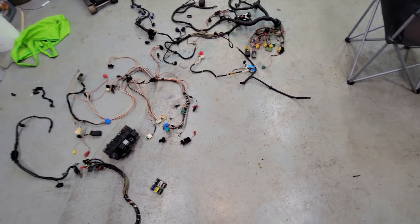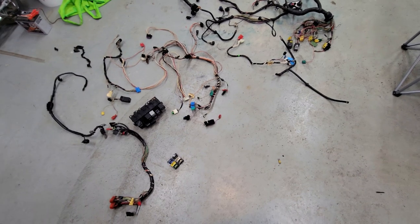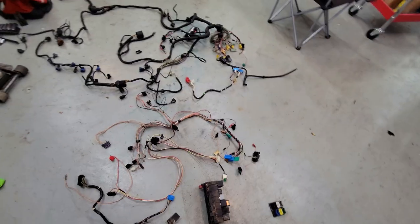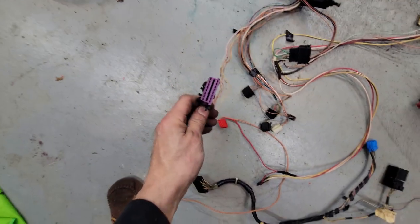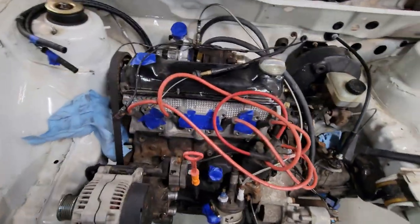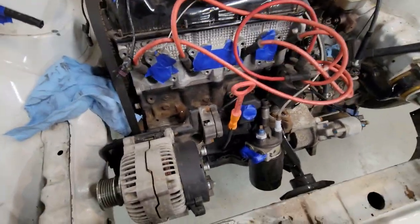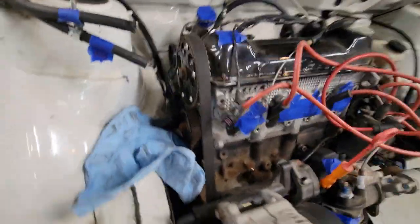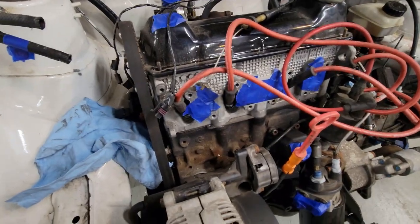The goal is to have this car look like it was wired this way from the factory, so that if anybody has problems with it — i.e. my buddy — he can take it anywhere and get it fixed. And we're also going to make sure, because there's no point to having OBD2 without a Diag port. In regard to the motor itself, it's got a head spacer — I think it's 8.5 to 1. It's got an adjustable cam gear, which I'm not going to screw with too much. I'm going to set it to 0 and leave it alone.